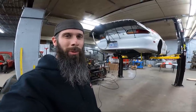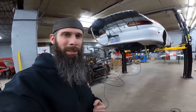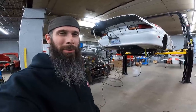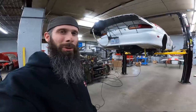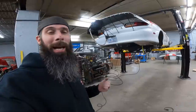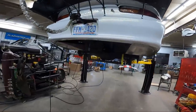What's up guys, we're back with the Grub Worm 2022 updates. In this video we're going to be talking about the wishbone setup. We're going to be using the Hammer Concepts and Designs wishbone kit. It is a really beefy wishbone setup — it uses an inch and three-eighths 7075 slider, it's got Delrin bushings where you don't have to use grease. I'll go over all those details in a minute, but right now I'm going to show you under Grub Worm and talk to you about how we're going to tie it in and show you the rear.